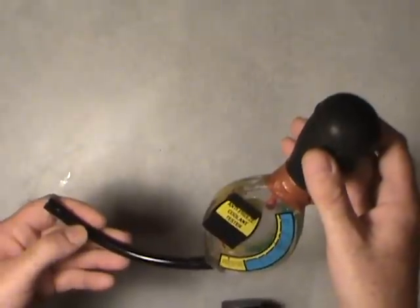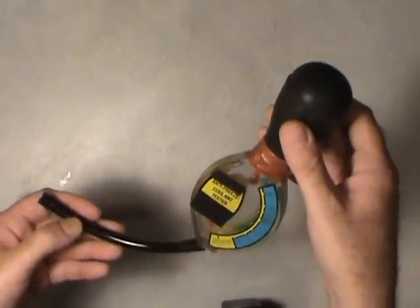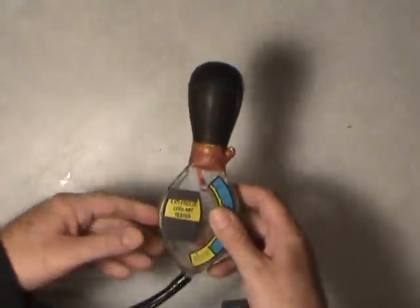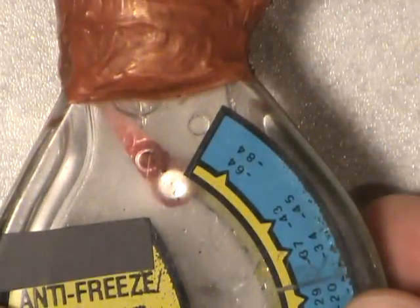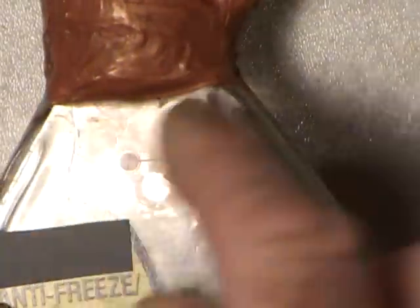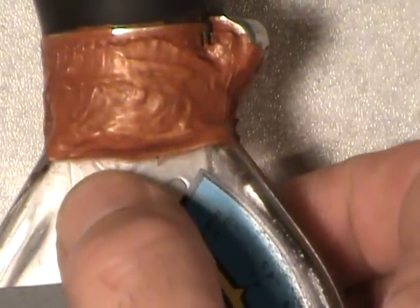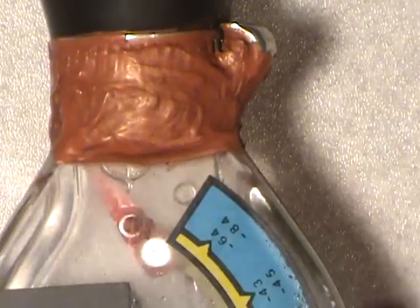And a little of the technical stuff on mixture and concentration — what you'd have in ratio to the water. So you draw it up there. There's a little needle right there. What I've done is it's sitting horizontal so it won't really indicate properly. But when this thing is upright and it's full of fluid, you keep drawing fluid up until you can no longer see the fluid — it starts entering up into here. This needle will float. There's a little circle with some crosshairs molded into the plastic there. And when that needle's pointing upright, that means it's level and it's ready to take a reading.